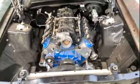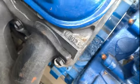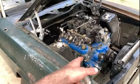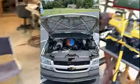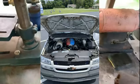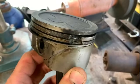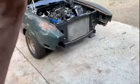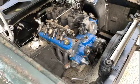Let's go under the hood. As you can see, it's not a 351 Cleveland — it is a 5.3-liter Gen 3 LM7 with 862 heads, pretty much your typical junkyard-find Tahoe engine. This is actually the engine out of my 2003 Silverado that was turboed. It has a blue number-seven piston from being over-boosted — like 50 pounds of boost — and I drove it home blowing white smoke, then pulled the engine.